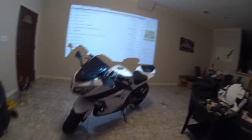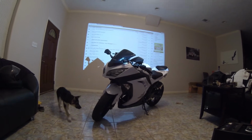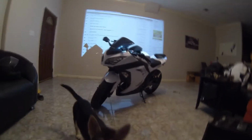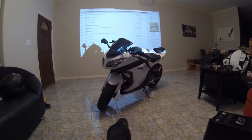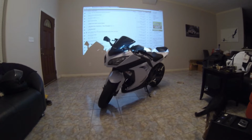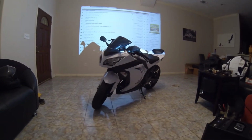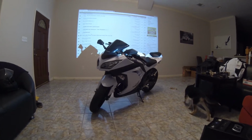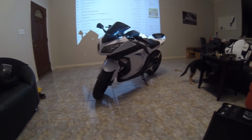But yeah, I'm getting about, I'd say somewhere between 55 and 65 mpg, and I've been getting on the bike pretty good. I'm doing a hard break in. I did my first oil change at 50, got out so many metal flakes, and I'm approaching 300 miles now. I'm considering doing another oil change at 300, but I'm unsure.